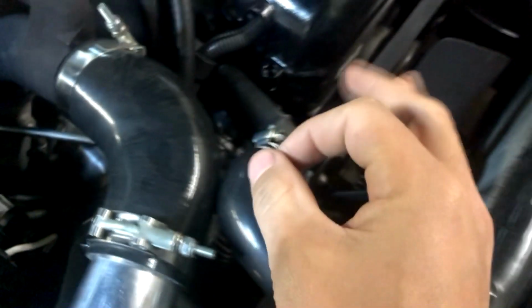The O-ring for this side was actually missing somehow, but we were able to replace that, and I found the water leak. You guys won't be able to see, but hold on. The water leak was actually right where that neck part is down there, and it was leaking from underneath. Put some RTV there, and hopefully that should be good. Filled up with some coolant, and gonna bleed it.